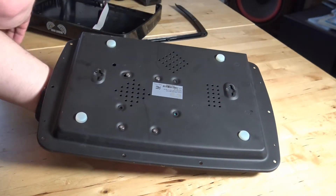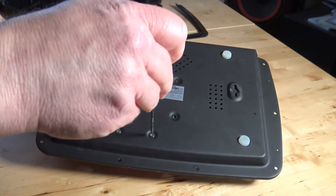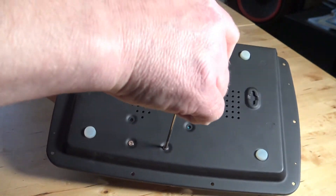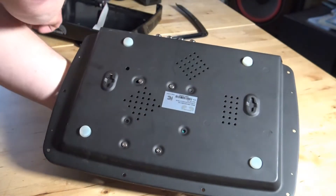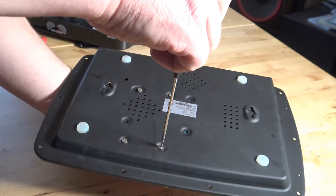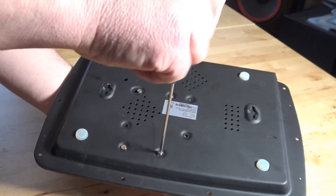It's time to remove the hard drive. What you want to do is put your hand on the hard drive to support it as you remove the screws from the back of the DVR. There are four screws that hold it in place.